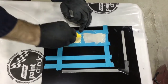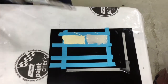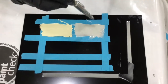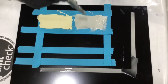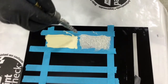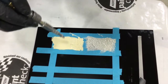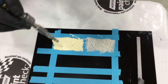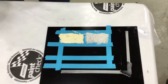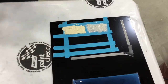Again, in all cases it's best practice to apply seam sealers over a two-component primer product — DTM products can be applied over a two-component primer as well. Here I have a blow gun, and in this case it's going to be used with very low pressure to apply patterns to the seam sealer. You can use the blow gun in circular patterns, back and forth, moving in and out to create a whole variety of patterns. This will vary depending on the shape of the blow gun head, the pattern used, and the viscosity of the seam sealer — and may replicate seam sealer found in floor or trunk areas.